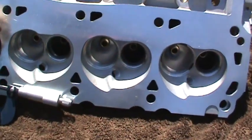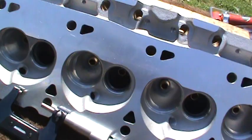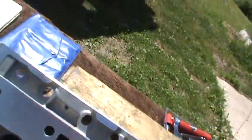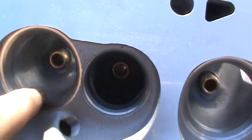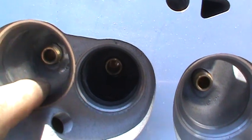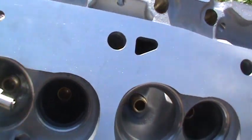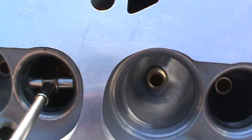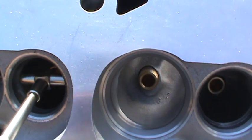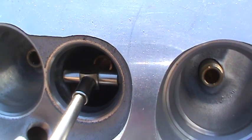What I do is I put my T-gauge in there so that it just fits in there nicely. The area where you're going to get the most power and the most bang for the buck is in the area underneath the valve seat. See, the valve sits here on the seat, and this area right in here is called the throat. That is what these measurements are for — this is the throat size, and that's the size you want to make the throat. So here's my exhaust, and I said it was 1.386. Right now I'm in the throat area, just below the valve seat, and I get a little bit of resistance — so that's right at that size right now, and I've already done a little bit of grinding.